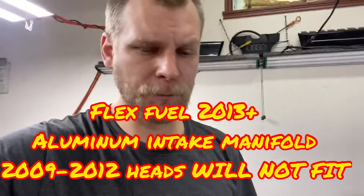Especially for the flex fuel cylinder heads, you're just going to have to get it rebuilt. This is one of the main reasons why you don't just want to throw valves in and lap them in — I've seen people do it before, but I don't trust that. I prefer to get my camshafts polished, have the cylinder head guy inspect it, put new valve guides in the exhaust side if needed, and have them go through it and make sure everything's good with the valve job. They don't just lap it in with compound — they actually use their machines and give it a proper valve grinding.